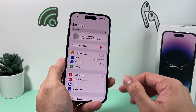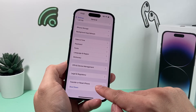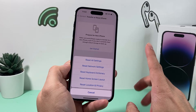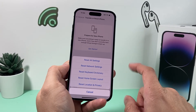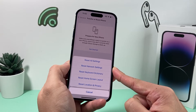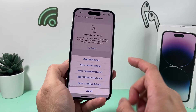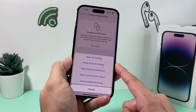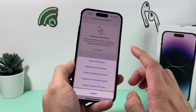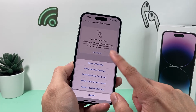If you're still having issues, the next step is doing a network reset. Go to Settings, General, scroll all the way down, and tap 'Transfer or Reset iPhone,' then tap Reset. Choose 'Reset Network Settings.' A network reset deletes saved Wi-Fi passwords and connectivity settings, but will not delete your photos, videos, apps, or media. It's a good step if your phone says there's no internet even though it seems connected. The process takes just a few minutes.